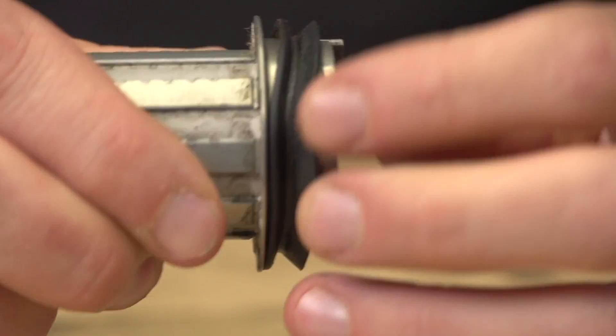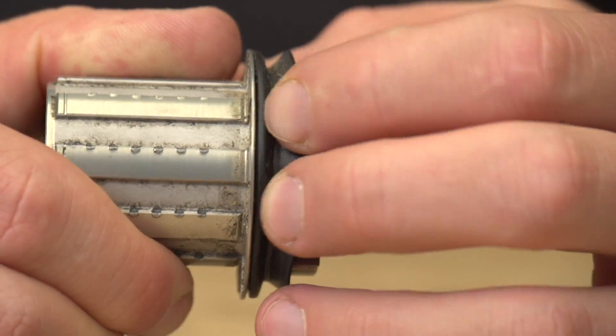It's actually a really well-sealed freehub design from Mavic. On the freehub, in between where the freehub sits onto the actual hub shell, you have a rubber washer like this. I'm pretty sure that's your problem. This rubber washer does an amazing job of keeping water and grime out. However, it doesn't do so well dealing with friction — the rubber washer, from time to time, can press against the actual hub shell, and as the hub shell spins, the freehub starts to spin with it too. That can also cause a noise. I had a pair of Mavic wheels and they made a really loud screeching noise when freewheeling — only on occasion though, so it wasn't too bad.